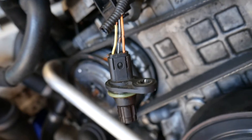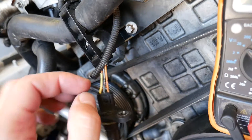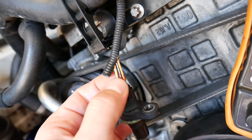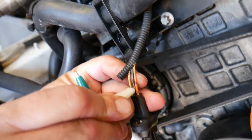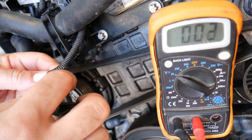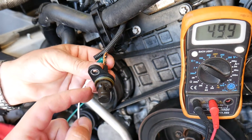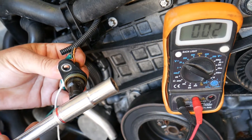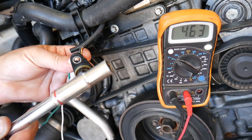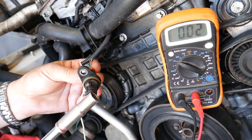Now we need to test the signal wire and the ground wire. We peeled them slightly — I wouldn't recommend cutting them; there's a special tool you can use to poke them without cutting. We connected alligator clips to the yellow 5-volt signal wire and the black wire. It's very important not to touch the two wires together, as that can damage your electrical system, burn a fuse, or even burn the engine computer. With the clips attached, you should read about 5 volts. When you place a metal tube in front of the sensor, the voltage should drop to zero. Remove the tube — 5 volts. Apply the tube — zero volts. That confirms a good working sensor.